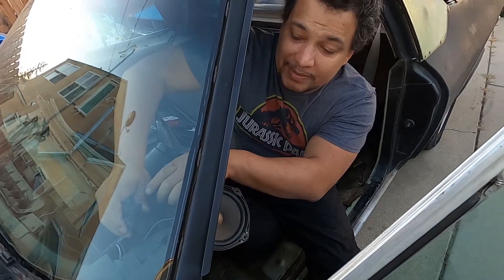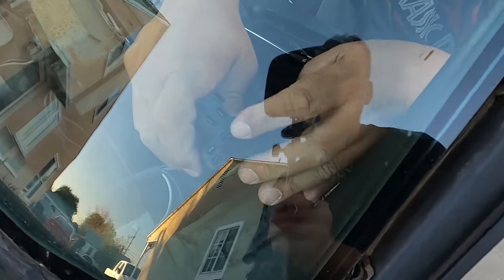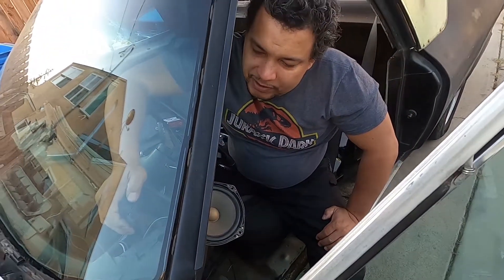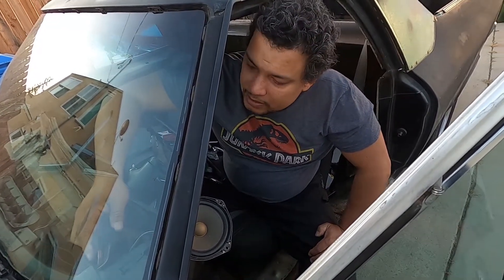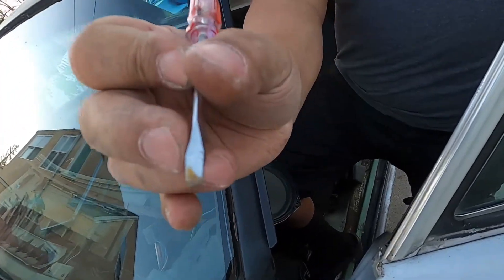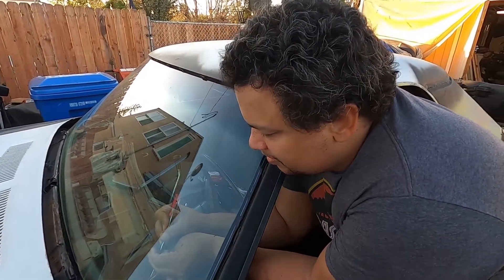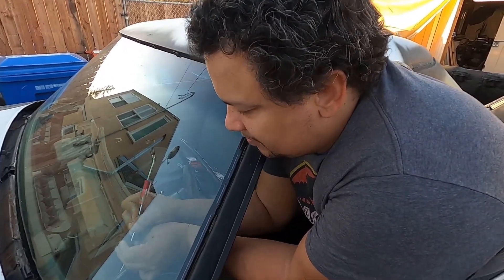What I'm going to do before anything is take a really thin flat blade screwdriver and start to scrape the contacts, just because I'm here right now and I want to make sure I clear these all off. It shouldn't be too hard or too crazy — just give me a few and we'll get these cleaned up to make sure we're making perfect connections. Just to show you guys what's on there — dirty. Let's try to clean each one, do one at a time. Don't try to cross these connections — yeah, spark, fire, you don't want to mess up anything. Take your time, and especially if you have a new windshield in there, please don't scratch anything. Use the smallest flat head you can and scrape away.